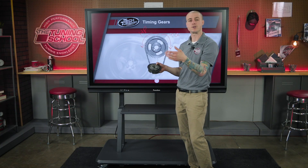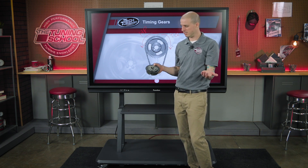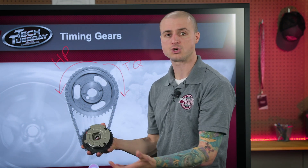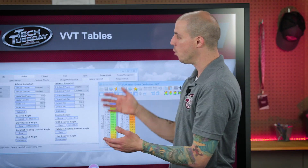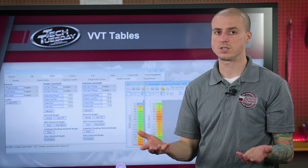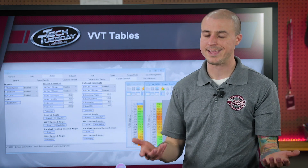You can end up with more horsepower in your higher RPM areas and more torque at those lower areas where you want it. When we jump into the tune, what we can do is phase this back and forth, all controlled by oil pressure in your vehicle. On this specific vehicle — a Hemi-based vehicle — we have a single camshaft, but two tables that are actively working. The intake cam is disabled, and we're driving specifically off the exhaust camshaft. In our Dodge course, we also have a calculator to help you come up with new numbers to find peak torque and peak horsepower.